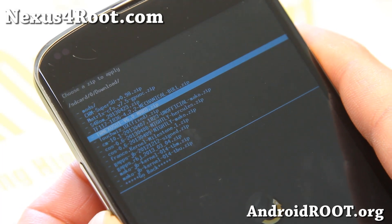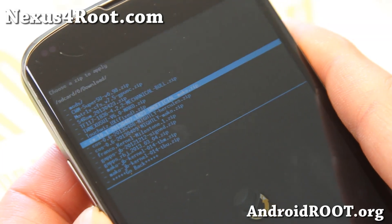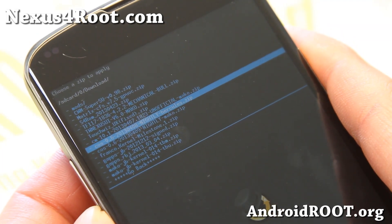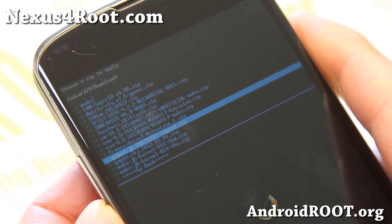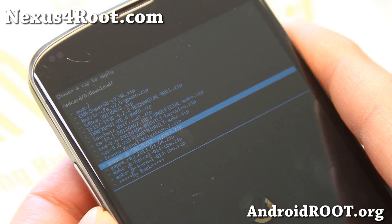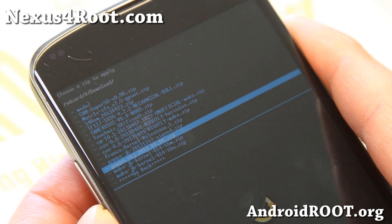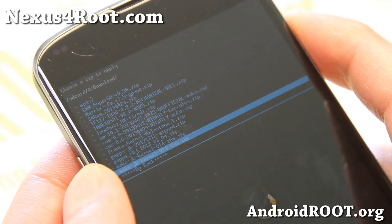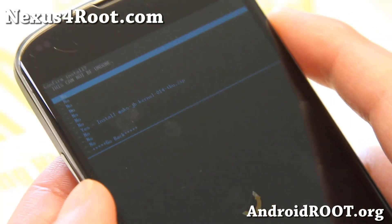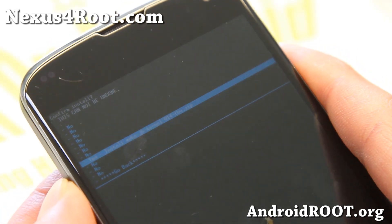You'll see I've tested some of the other kernels here. Also, if you don't need overclocking, try the Matrix Kernel, which also comes with GPU overclocking enabled by default. The kernel file — this is it — Mako JB Kernel TVU. This is the Ultimate version. It's just a zip file; you just install it and it will install the kernel.